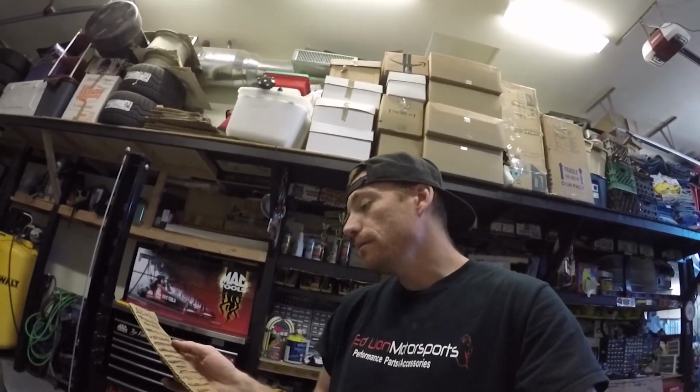So the only things that I have left are those two wires to go from the dash display into the ECU, the CAN low and CAN high. I ran out of those little terminal connectors for the ECU, so I'm gonna go see if I can find some at O'Reilly's. And then after that, go ahead and play with the dash, because there's a lot of cool features that you can do with that, adjustments, figure out the gauges and all that, and then just an oil change, and then the car's ready to go. So head off to O'Reilly's, I'm gonna see if I can find that.